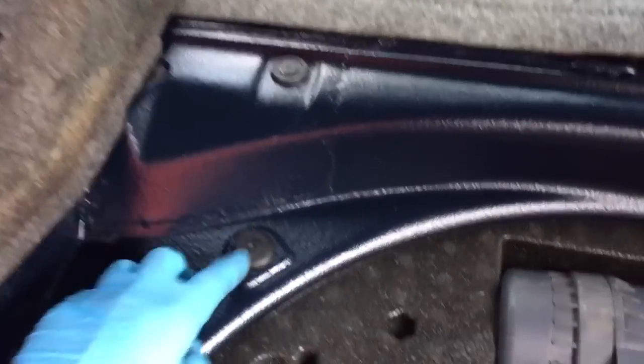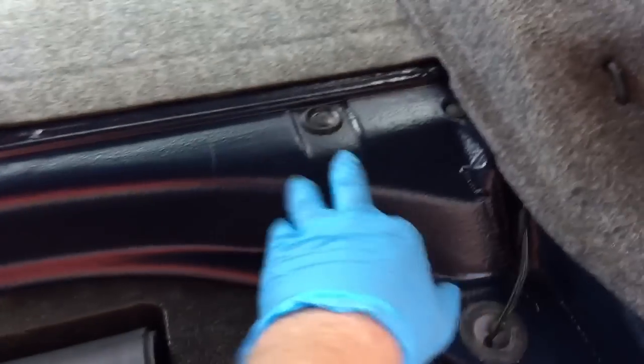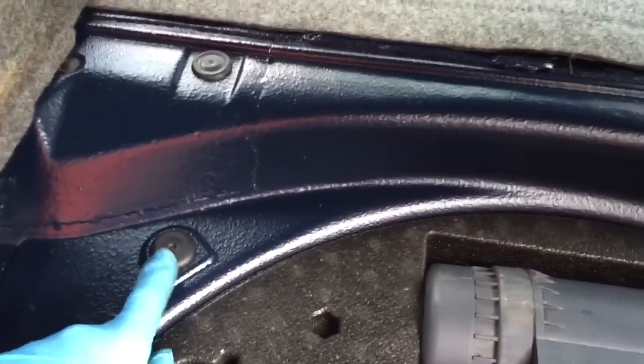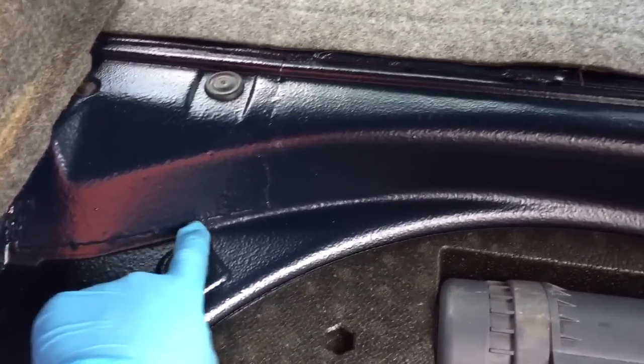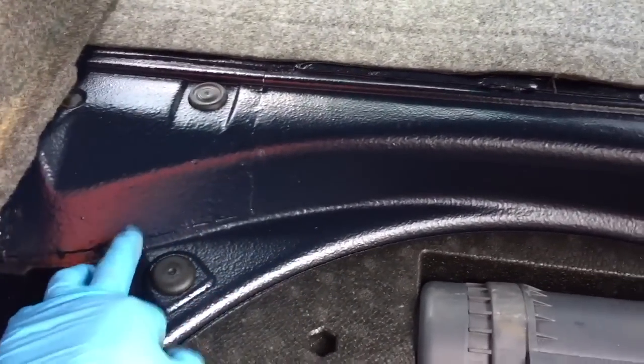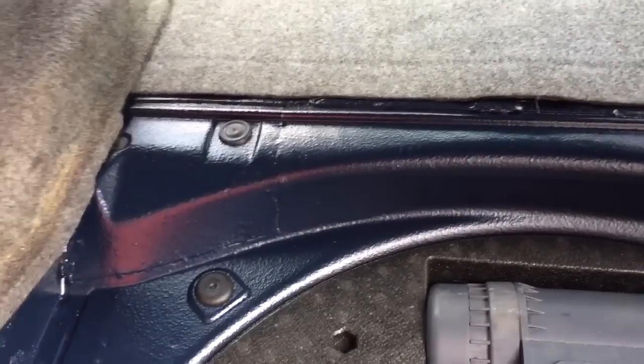And we replace all the grommets as well, so grommets are back in, they're not over painted, all in the correct way, and you've got that nice textured finish on the floor and body colour paint. And you can just see the outline of the cut there where we opened this panel up, and then we've welded it back on, and that was to get to the cracks inside here in the cavities. So if you see that on your car, then you've had a repair in that area.